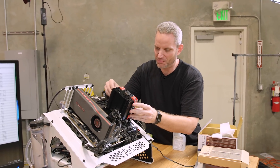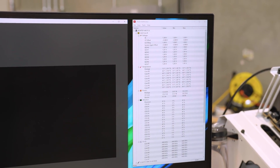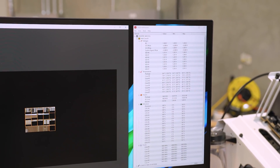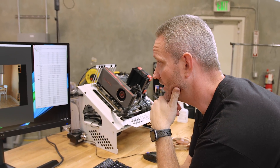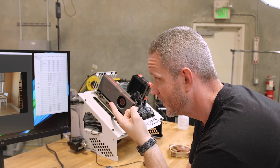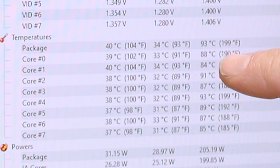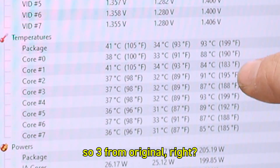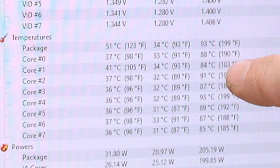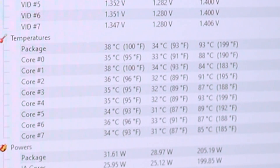Last test: the 2400 RPM Maglev fan is on there, definitely moving a ton more air. We'll run two minutes and see where it lands. So far the temps are significantly cooler — we lost seven degrees Celsius by putting this fan on there. That's three degrees back from the original unpainted baseline. So I bet we'd be at 90°C or less with this fan and the cooler unpainted.